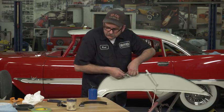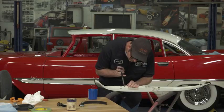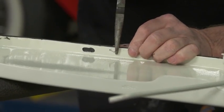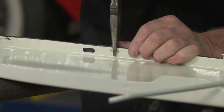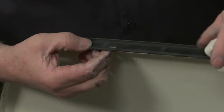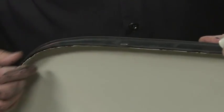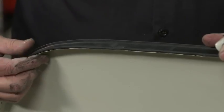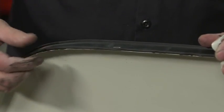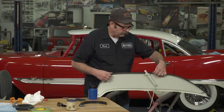The staple goes through the holes on the other side. We'll just put the staples into the holes and fold over the ends on the bottom using our needle nose pliers to crimp them down tight. This recreates the look of the factory staples you'll see in most 50s, 60s, and 70s cars — without having to go out and buy yourself a half-million-dollar machine. We'll just continue that process around this skirt. Now we've got not only a chemical bond with the weather sealant, but also the factory-looking staples all the way around, and we'll be ready to get these on the car.